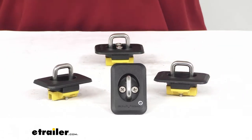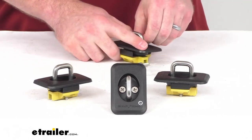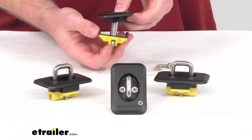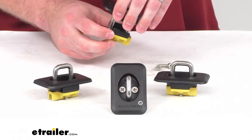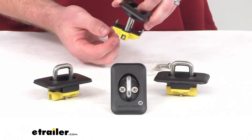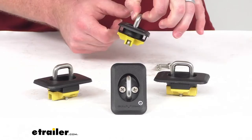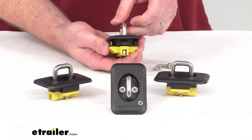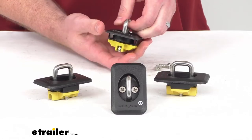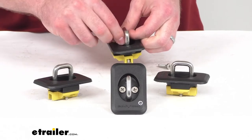It's very easy to get these installed. All you have to do is remove the screws that attach the top bracket with the lower bracket. That's going to give you some more room to finagle there so you can get this lowered into your stake pocket, kind of angling it down. And then once it's inside, these side plates are going to act as an anchor — pull up on that ring and that's going to lift the whole system up so that it catches on your truck's sheet metal for a nice solid connection. Then once you pull it up, just reinstall those screws and you'll have a nice firm connection to your truck.